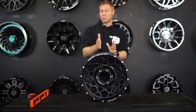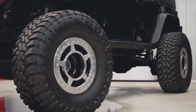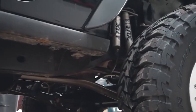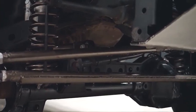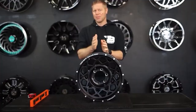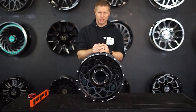So why is it important to know this information when purchasing wheels and tires? Because once we start modifying our suspension or adding larger tires, high steer flat top knuckles, long arm suspensions, hydraulic assist steering, full hydro, or any other mods that may cause clearance issues with the wheels or tires — whether they are pointed straight or turned either right or left at full lock to lock — we need to know that there are options available to solve these clearance issues by pushing the wheels and tires outward and away from those components.